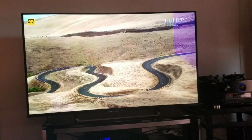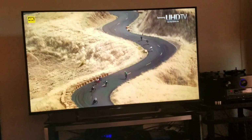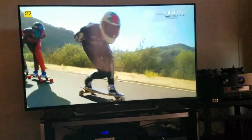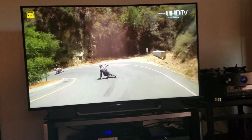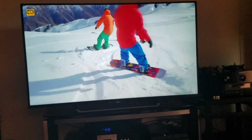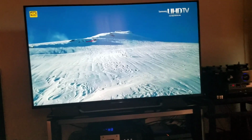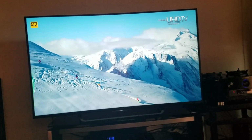Blu-ray discs deliver Atmos using TrueHD, technically, with Dolby Digital Plus as an available alternative. That is how Blu-ray discs give you Atmos, guys. And broadcast and streaming services deliver Atmos using Dolby Digital Plus, technically. On your Vudu, your Netflix, your Roku boxes, they're going to be delivering Atmos via Dolby Digital Plus, and that's how your receiver's picking up that codec and converting it.